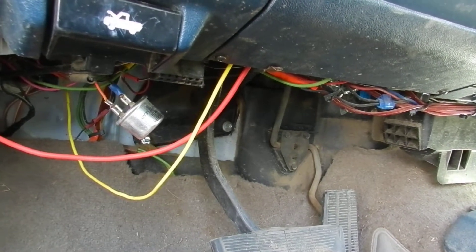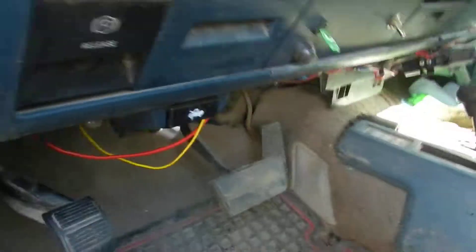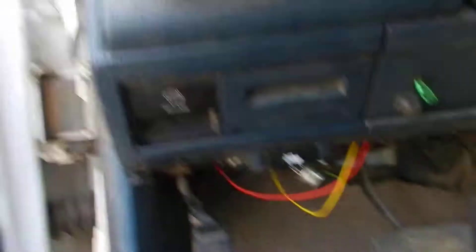What I did was I plugged it into the fuse panel on a 12-volt positive terminal, even when the key is off. It's up to you if you want to do it on a keyed source or a non-keyed source — I don't really see the harm in doing it non-keyed. This way I can turn the glow plugs on even when the key is off, run them a few seconds, then turn the key on and start the truck like normal. Disclaimer: I'm not responsible if you burn your truck to the ground. This is mainly just to help me out on warm startups — I can hit the button for a few seconds and the truck will fire right up. Thanks for watching.